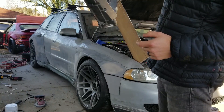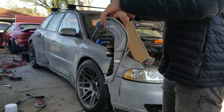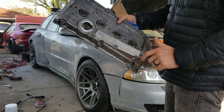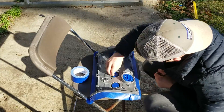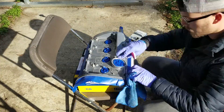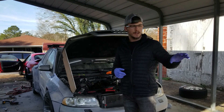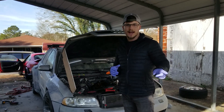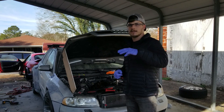I let the valve cover dry for a day — it's not all the way dry, but that'll be okay. Underneath here, around this edge, in these holes I'm just not gonna spray paint in there, and inside of here I don't want paint to get in there either. So basically anywhere I don't want paint I'm gonna put some tape on, then we're gonna degrease it with some wax and grease remover and it'll be ready to be painted. I cleaned that off with wax and grease remover and used a toothbrush to knock off some of the dirt from the recesses. I'm using a black hammered finish because it's gonna match some more parts I'm putting on my engine.